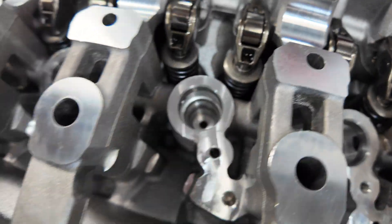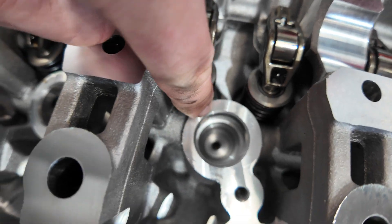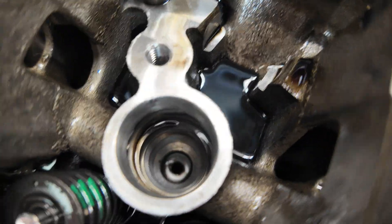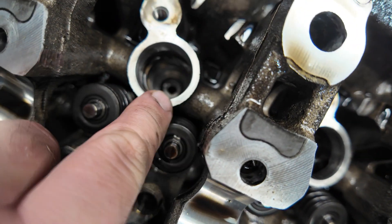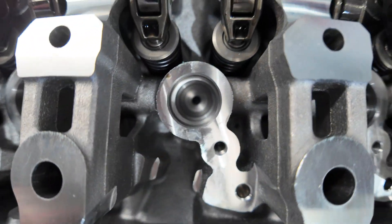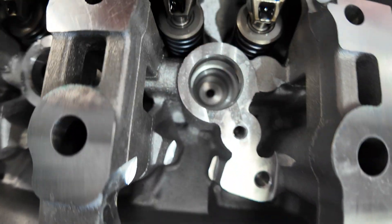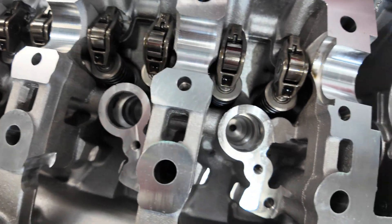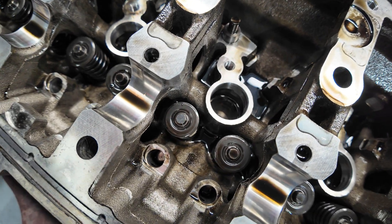Some of you might have heard of the AMC cylinder head. It has a thicker bucket — this wall area here is thicker on the AMC. You can see this one is quite a bit thinner. The AMC is way thicker — I'm guessing around eight mil on the AMC versus maybe four or five mil on the original. It's this wall area that cracks, and you can just feel the difference.